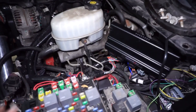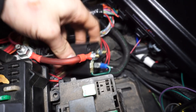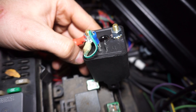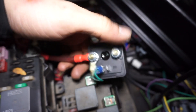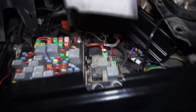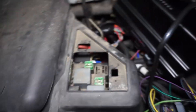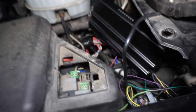I took the fuse box cover back out and I'm going to mount the relay right there. I heat shrank the 8 gauge line and put a little jumper for power — it's got two spade terminals on the bottom. I ran power over to here; ground is going to come from the ECU, and then it'll pass power down to the fuel pumps. Got the cover back on in its normal spot — you can see the relay in there and it doesn't hit anything.